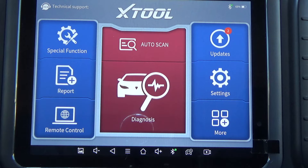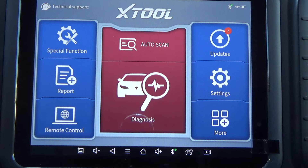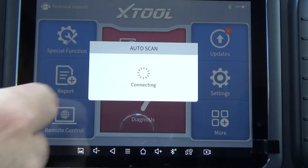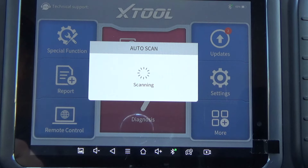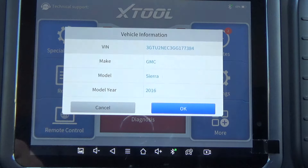The title of this test is Fuel Injector Balance Test with the Scan Tool. I am going to put the exact procedure in the description so you can print it off and walk yourself through it. First thing: turn ignition on — we are on. Then command the fuel pump enable on with the scan tool. Let's go ahead and get into the vehicle. I actually jumped the gun; I should have already been connected here but I'm not.